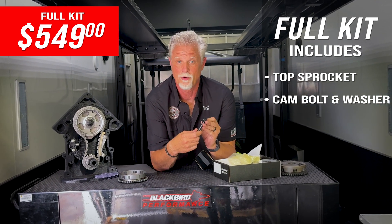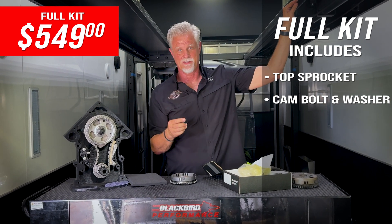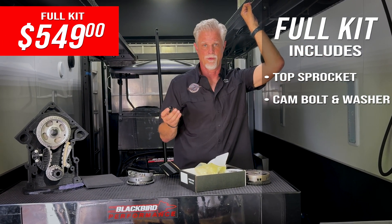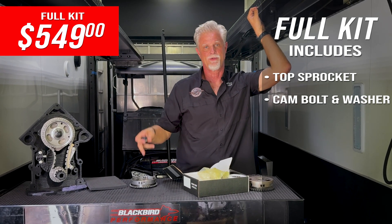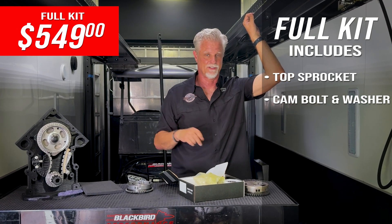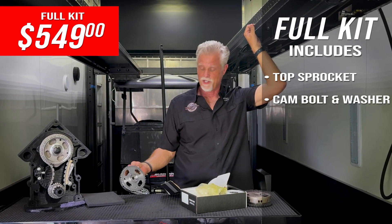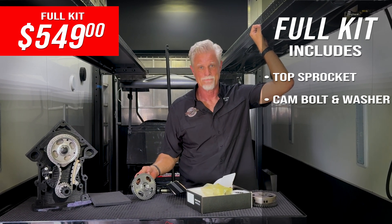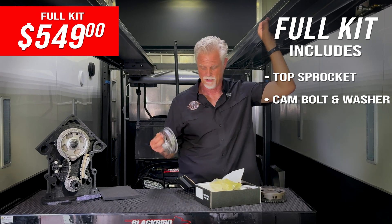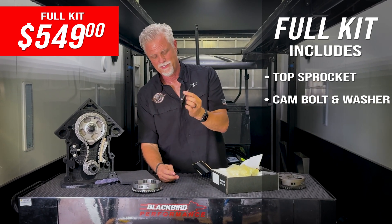In addition, you'll get a cam bolt designed specifically for this system. It's an ARP bolt with a special washer to retain it. This ARP bolt is stronger than factory spec — the factory cam bolt torques at 90 foot-pounds, but we want you to torque this one at 100 foot-pounds, increasing the clamp force between the sprocket and the cam by more than 10 percent. We're very confident with that clamp load. We've used it at very high valve train loads, very high valve train speeds, and high spring pressures, and that one bolt at 100 foot-pounds works very well in all the applications we've used it.